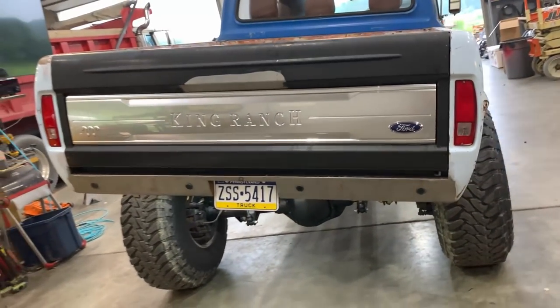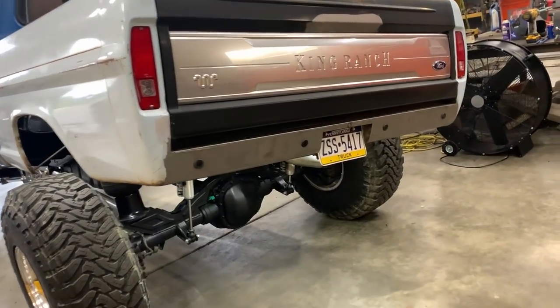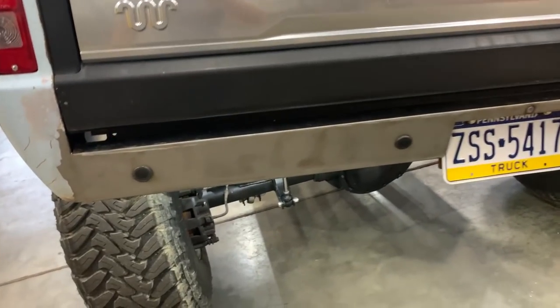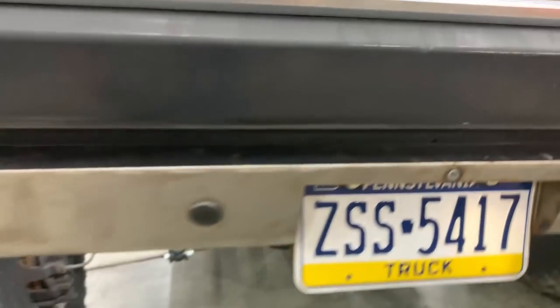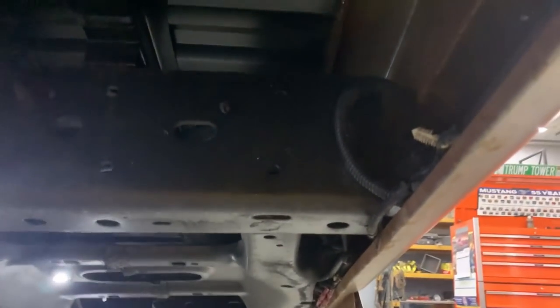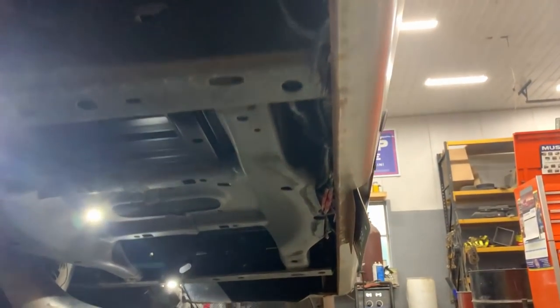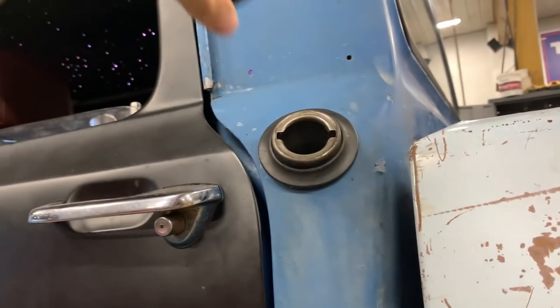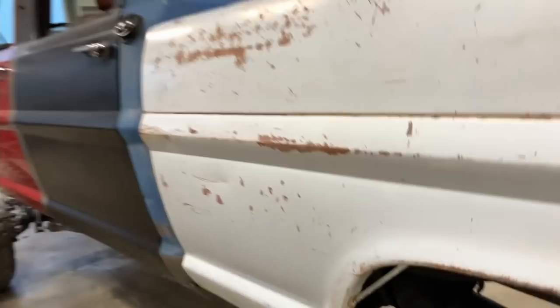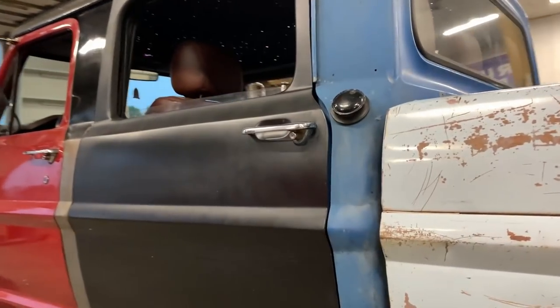I think it's a nice touch. There's a lot of people that don't like it, but I don't really care. To match the clean shaved look of the handle and the tailgate badge, I did a roll pan. I know a lot of people don't like the new school look of roll pans, but I really don't care. That is the '14 backup sensors and the '14 backup camera over top of the license plate. The frame rails I had to chop off about two inches to get everything to fit. For the filler neck, it is the '68 factory location that goes down through the cab, through the box with the air fittings in the bed, and back into the factory location of the 2014. So I have the look of the gas cap inside the cab, but it's actually underneath the truck — safe, no fumes inside.